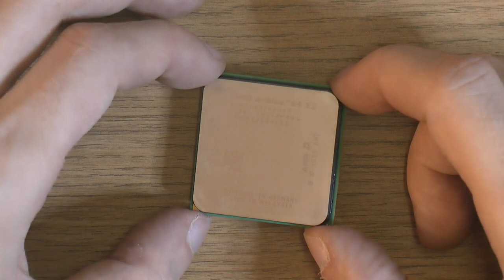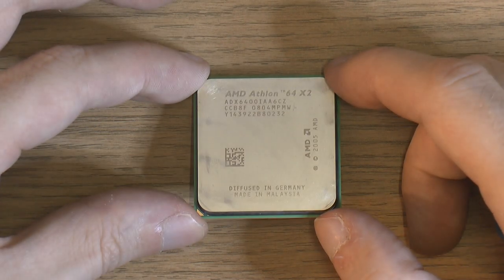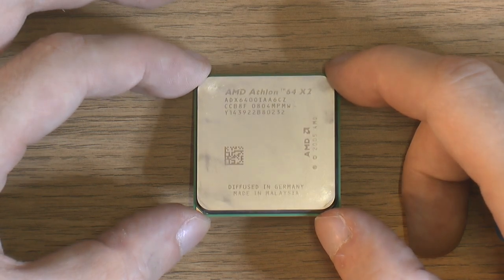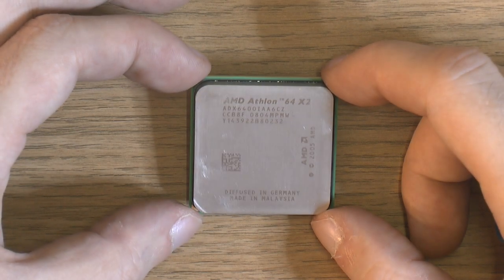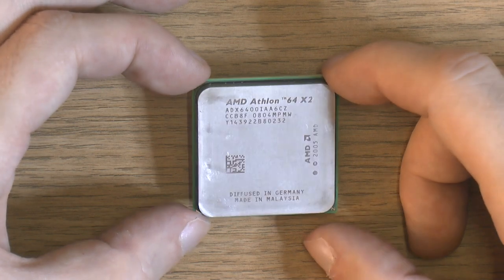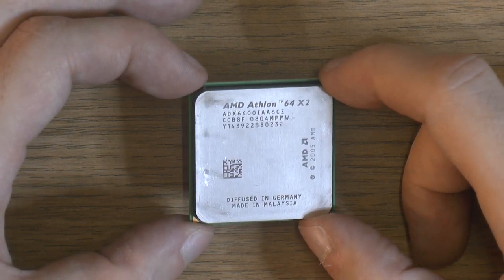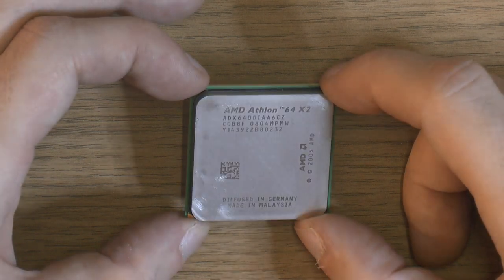And I don't find this CPU to be limiting the GTX 295. Like, if you start up Crysis with the 295 versus the 260, the 295 is noticeably faster. And you really want to run high resolution anyway. That's kind of the point with an SLI setup, I would say. The GTX 295 is marketed kind of as a 1600p graphics card, and that's because you had 1610 monitors by then. So today it would be like a 1440p graphics card.